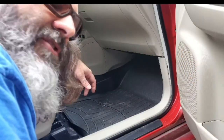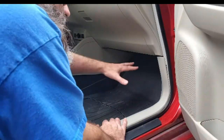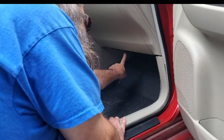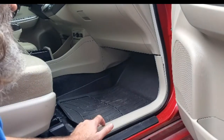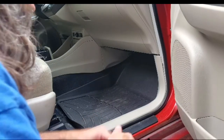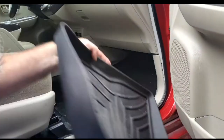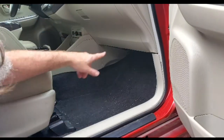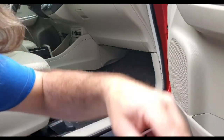We're down here on the passenger side of the car. This is the glove box and this is where the passenger's feet would go. The blower motor is directly up under there, right where the passenger's left foot would go. The way I do this job is I take the floor mat out, sit it on the ground, put my knees on it. There's a plastic panel we have to remove and I'm gonna show you that.